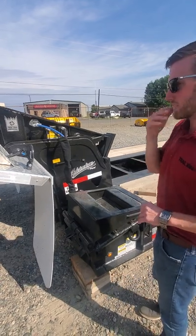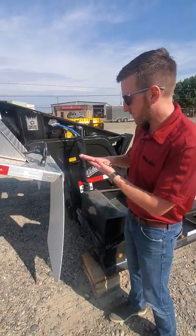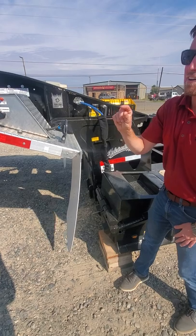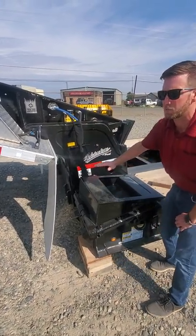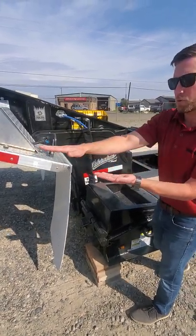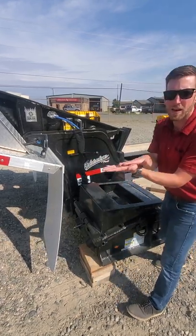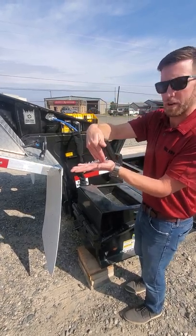A couple of key tips when detaching the gooseneck: when you go to lower it off the ground and lower your stirrups off the load pins, only bring it down about a half an inch. That way this riser box stays in line with the trailer as much as possible. When you drop the air in your truck and lower it off about a half an inch and pull off, when you come back to reconnect, the box will be at the same plane and hook back into place every time. If you lower it too much, it's at an angle and the lock pin doesn't want to go in right away.